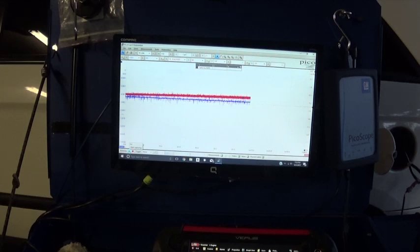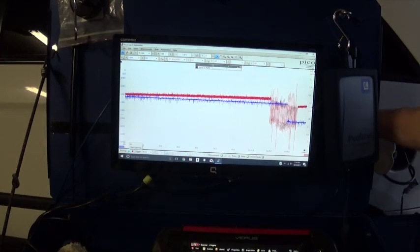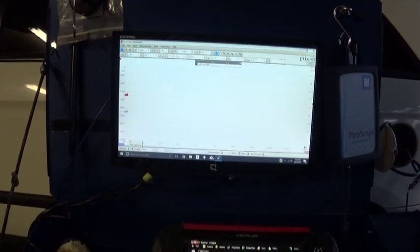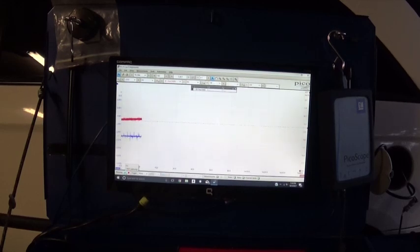So right now I'm just trying to do as much as I can with my vacuum pump. So again, now I got my vent hose pinched, plugged, so I'm going to apply the vacuum again and see. My computer is okay. When the switch goes to 0 volts, it reads as a closed switch, and let's see what happens now. You can see now my scan tool is fine. I'm at 0 volts right now, and again we are still losing a lot of vacuum.